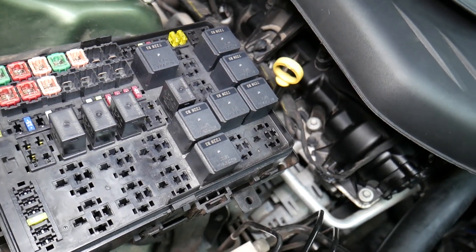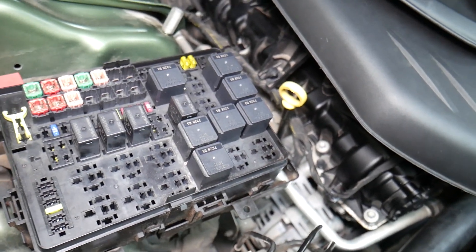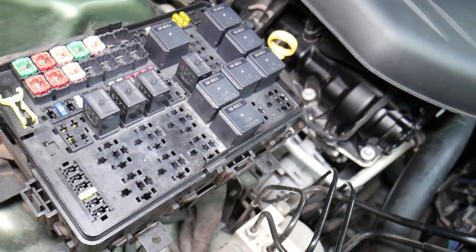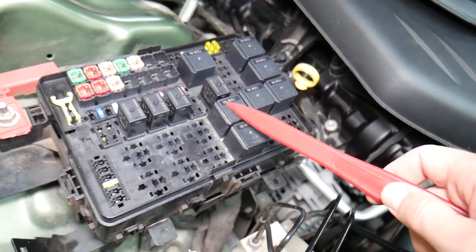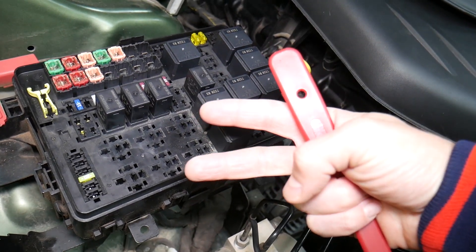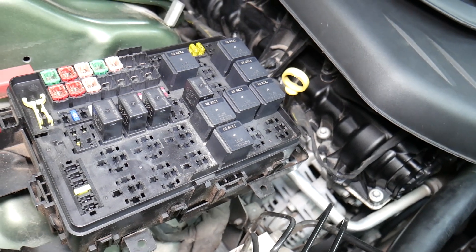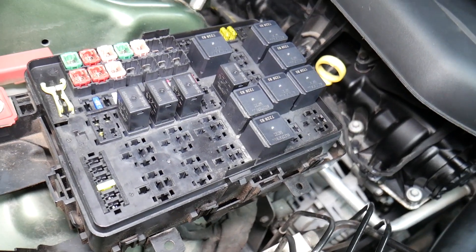For certain fuses, it's important to disconnect the car battery before removing them, otherwise you can burn the electronics. When working on airbag fuses or anything related, you need to wait at least one hour after disconnecting the battery — and if you're not qualified and certified to work on the airbag system, I'd never recommend doing that. Also, it's important to know which battery terminal to disconnect and reconnect first. If you do it the wrong way, you can burn electronics modules — we actually burned a traction control module on a BMW that cost two thousand dollars. We'll put a link in the description below on which terminal to disconnect first.